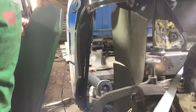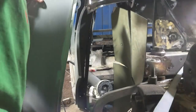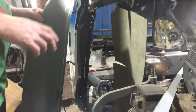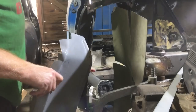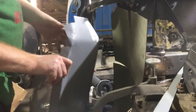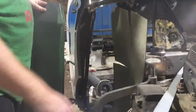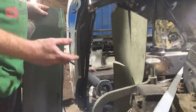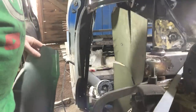I'm not too sure whether we're going to hole punch this wing first and spot weld through, or hole punch this bit and then weld through. I don't know what the etiquette is — I suppose it really doesn't matter. It just depends which side you want to weld from. Maybe if I did plug welds from the other inside, there's less grinding to do on the outside, if anything. The inside's all going to be covered with sound deadening one day anyway. Let's see if we can get it to fit or see what it looks like.